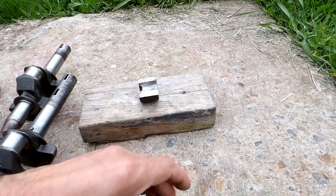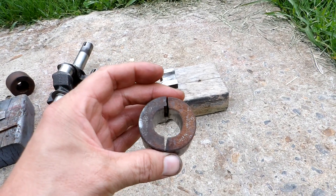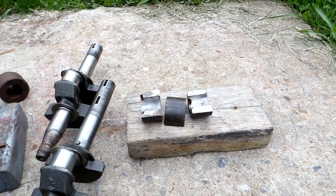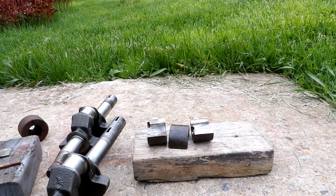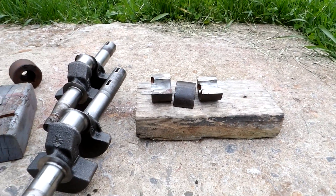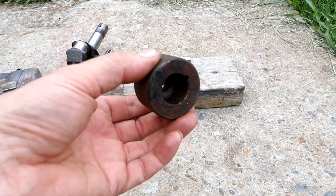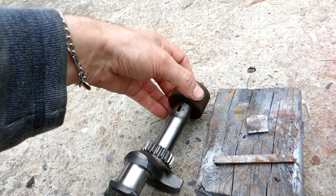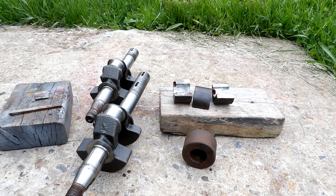As you can see here, just take your bushing, drill through it, cut it in half, and put two on the bottom to support the crankshaft and one in the middle. Use a press to straighten it, and use all the safety precautions you need to with the press. It appears that it works for me on these two crankshafts, so it's a fairly simple method. That's the lawnmower blade holder there — generally a short shaft one. If you give it a try, I hope it works out for you.